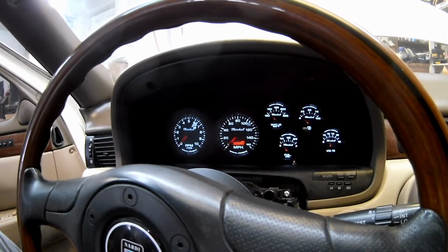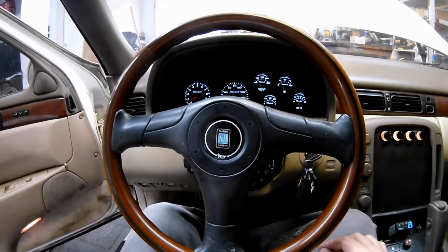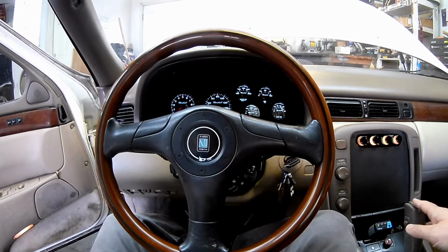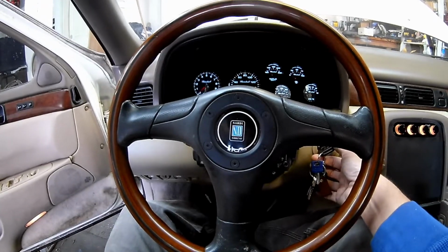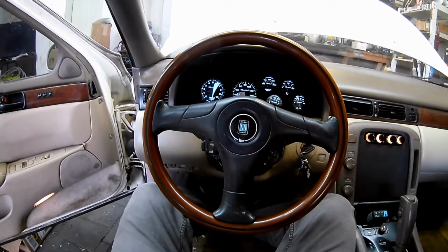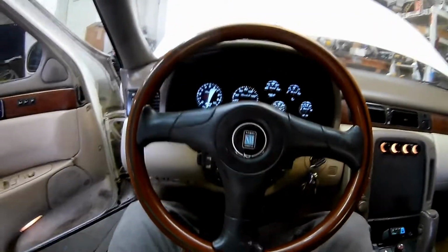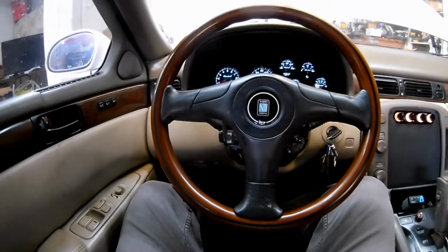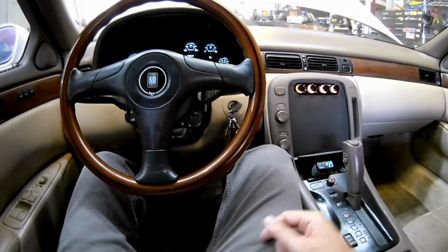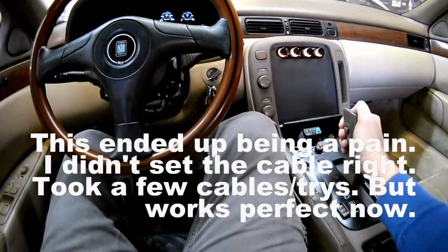Guess I can start it up. I'll show you what I mean by the vibrating. If it's not in gear, you don't get it. If it's in gear, idling, you do. So I haven't started this thing overnight. I mean, it starts like a new car. Idle will come down because it's just cold idle. It's up there for the first few seconds. So that's me sitting in the car. One other thing is the linkage isn't smooth coming out of park, which is annoying. So basically you have to go too far and then you go up into reverse.